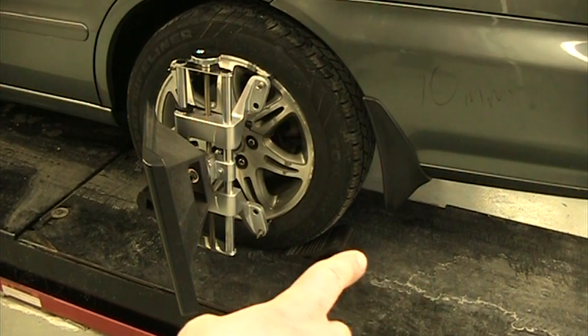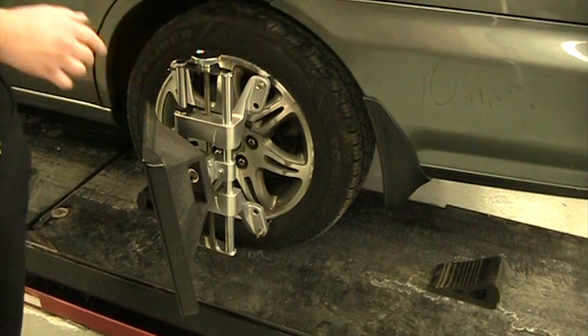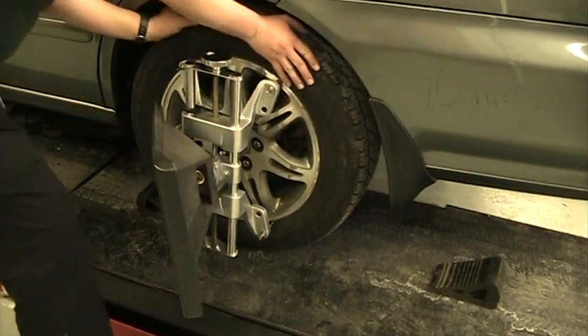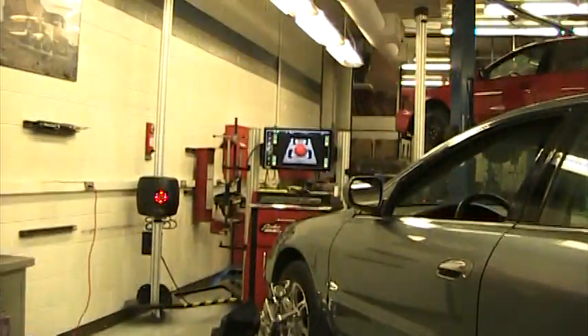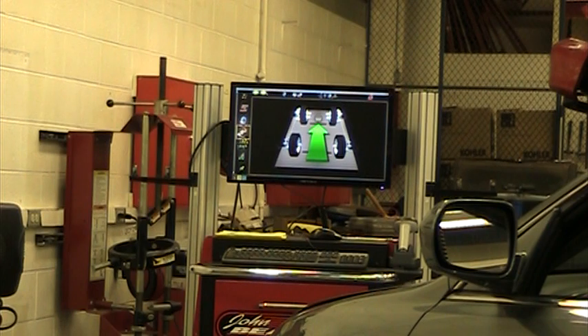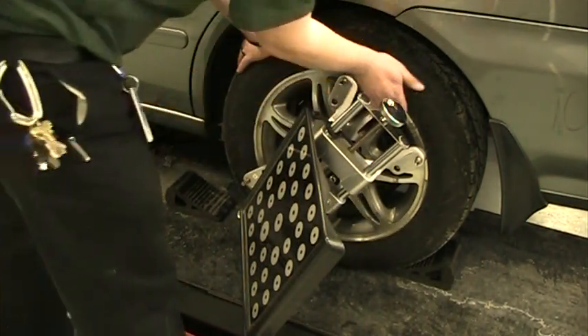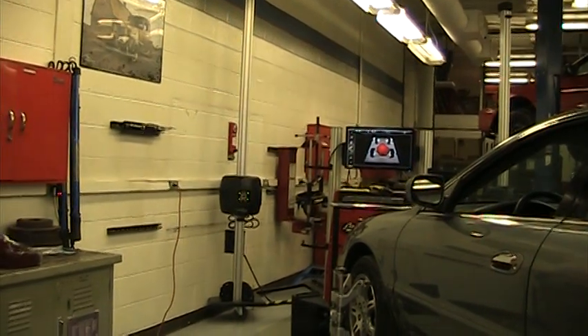We're not going to move the back wheel block all the way out of the way — we'll scoot it back about a foot, but it's still in the path of the wheel. Should the car get away from me, it will still stop the car. To roll the car, do not push on the alignment heads or they'll pop off and you can break them. Grab the tire and roll the car backwards. The screen will show a red stop sign — wait until the green arrow shows again, then roll the car back forward. Because I didn't move my front wheel block, it rolls right back to where it started. Grab the tire, roll it forward, then slide the back block in place. The stop sign goes away and now you can continue.